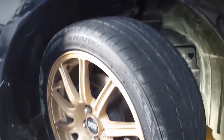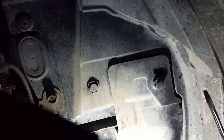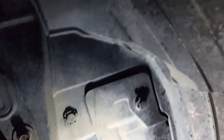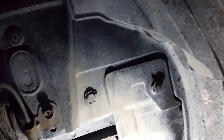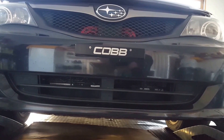Just a quick note on some of the newer Subarus: you'll have a skid plate, so before we drive it up onto the ramps, put it on the ground here and start up your car. Turn your wheel all the way to the right or left, whichever side you need to do first, and come in through the wheel well. You'll have a little plastic clip — all you do is pry it out and pull it out on both sides. After you take off the clip on the left side and the right side, drive the car up onto the ramps.